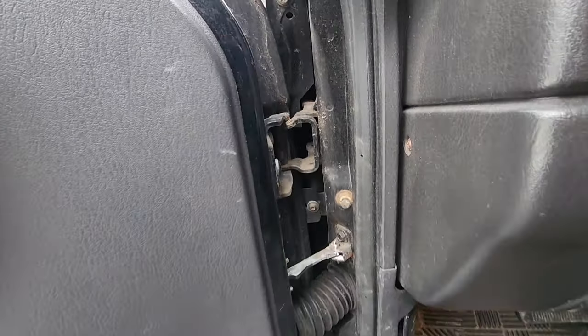Got it. And then once it was open, we dropped this interior panel. There's two clips right there. There you go. We reattached that little rod that opens up the tailgate, and we made ourselves a nice little modification. There we go, guys. That is the key to the fix. If you thread on two 10 by 24 little nuts and tighten them down on there, you'll have a nice little slide-proof latch. This should get the job done.